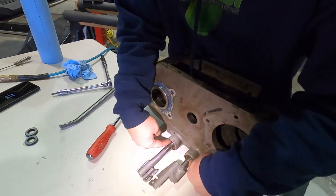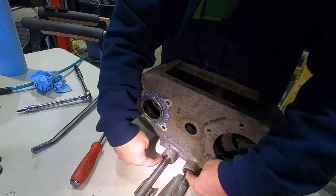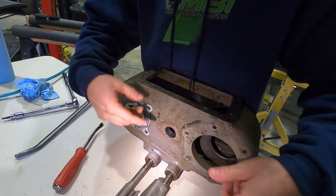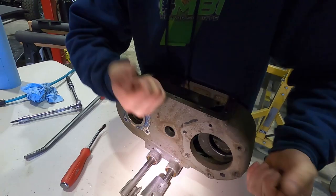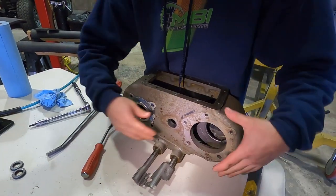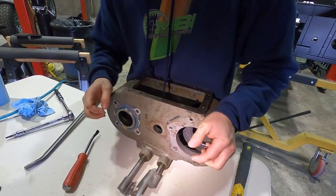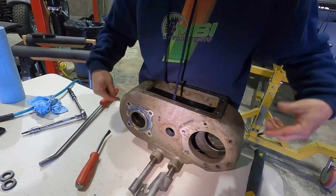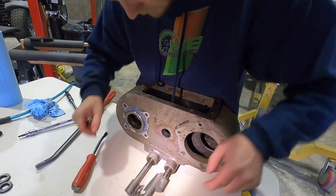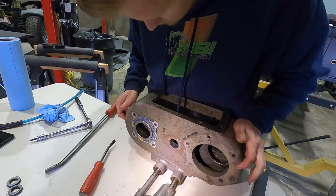Yeah, we have the new seals right here for these shift rails. Those are ones that a lot of guys don't do because everything else here, you can kind of just like, I've seen guys, you loosen them up, break it apart a little bit. I'm not talking about this particular transfer case, but all transfer cases. They'll break it up, squirt gasket maker around and tighten it all back up and it just leaks right here. Even though this is kind of usually up on a higher angle, but when you're wheeling and you're sloshing and you're sitting on your side, it'll end up leaking.